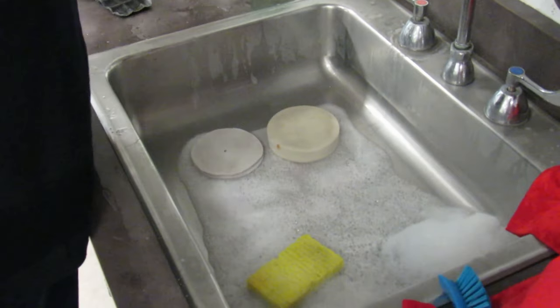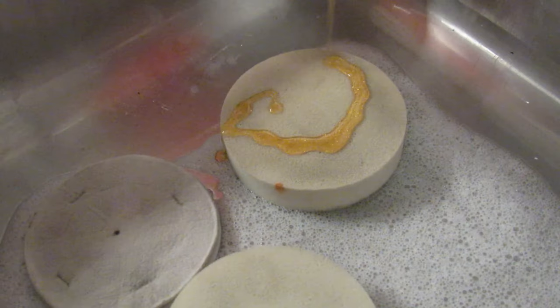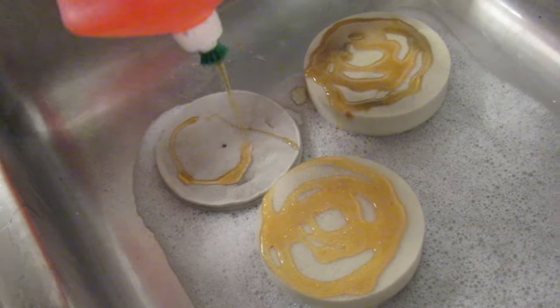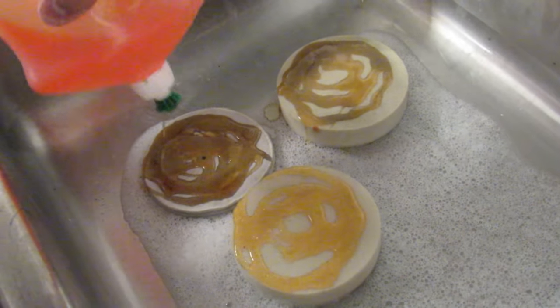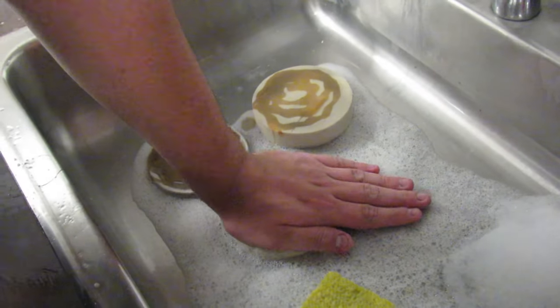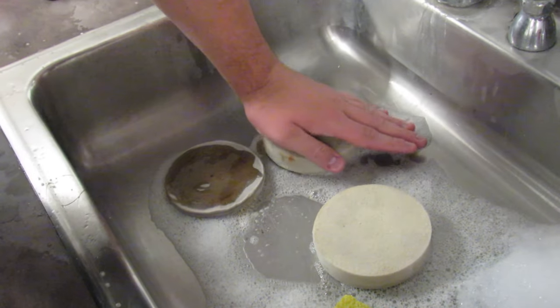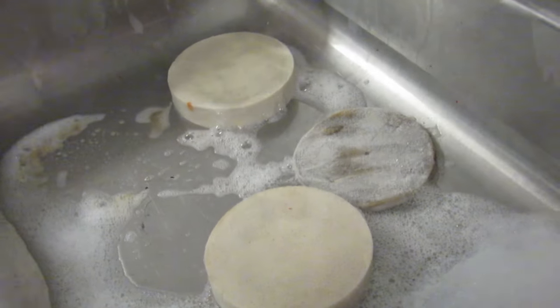Here's more, here's the three pre-motor filters right here. So how I clean these is I'm just gonna go like this across with a little trickle of dish soap. That is not a trickle. Well, I mean a little trickle at a time. Go and start squishing the filter to get the dish soap inside of the filter. Here's the third one. And then here's our HEPA.